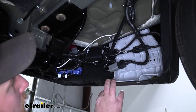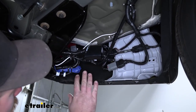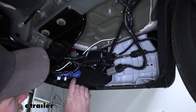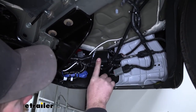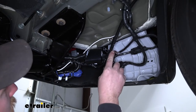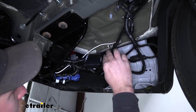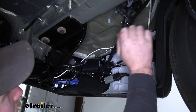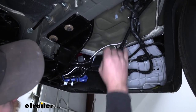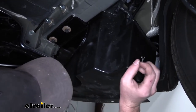Now that the butt connectors are sealed, I wrapped everything in electrical tape for extra protection and secured all the extra wiring — bundled it up and zip-tied it out of the way. I also secured the module box using zip ties to that bundle of wire so everything's nice and tight. Then run the big bundle of wire about a foot toward the front of the vehicle and out of the way. We'll continue routing to the front later, but first we can reinstall our panel.